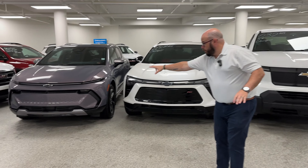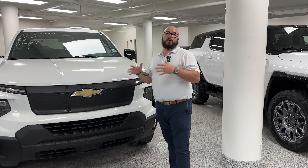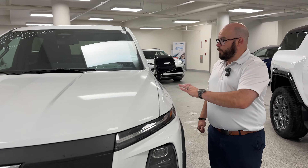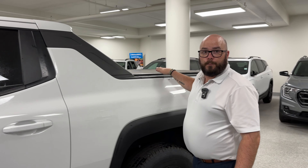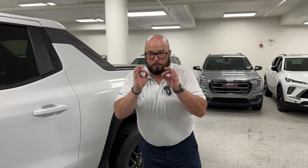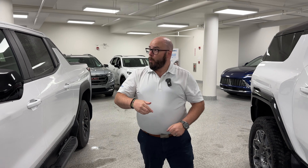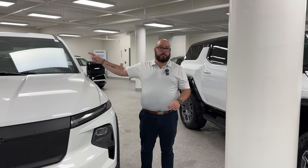Part of the reason I really want to focus on the Ultium platform is because GM has built all of these from the ground up with efficiency in mind. There are so many patents happening for the Ultium platform, and that efficiency is everywhere. Starting with the fronts of these vehicles — if you zoom in, you'll notice they are enclosed. Everything is about aerodynamics. You can still cool — if you're towing a Silverado, they still have open shutters — but for the most part everything is more aerodynamic. If you look at the back, there's actually no gap between the cab and the bed. This thing actually has the same drag coefficient as a sports car. It's so meticulous to make sure you get as much range as possible, as much power as possible — which is how we can have 632 kilometers of range, and that's the starting smaller battery.